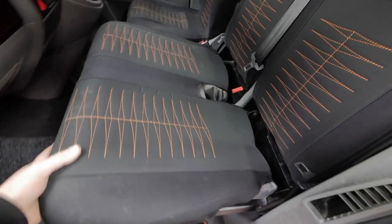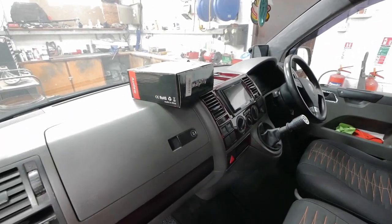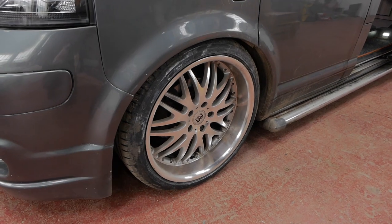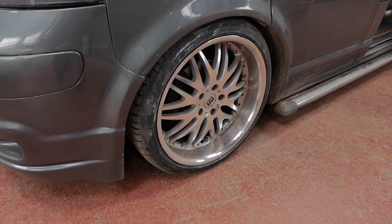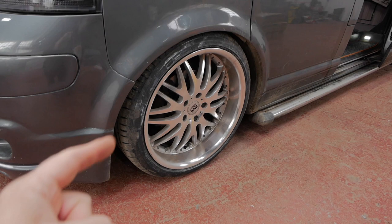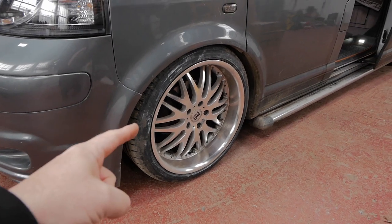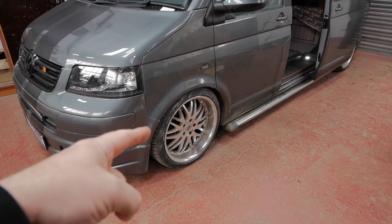Let's fasten this back up and have a look at this tyre inflator. You'll notice on these tyres there's white stuff around there — that's because these tyres are brand new. I've just changed them and it was because of bad tyre pressure. The tyre inflator I was using was a bit dodgy and I've actually been running around with 65 psi in these, which wore the tread out in the centres. These tyres were knackered — I've only had them on for about 3,000 miles, so this is the importance of good tyre pressure.